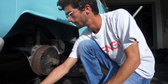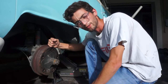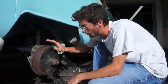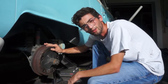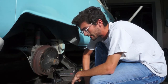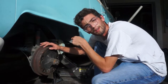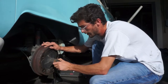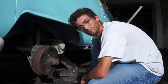I'm going to be taking apart this rear brake because it's been locking up on me. I don't know if it's because of the handbrake or the wheel cylinders. A lot of these wheel cylinders lock up after a bit of time because they're not really built very well. I try to buy German parts but sometimes it's difficult. We're going to open it up and find out if it's just the handbrake that needs to be greased, or if it's actually the wheel cylinder.